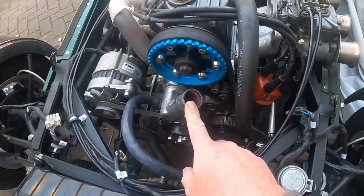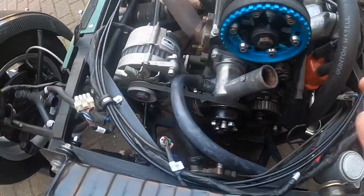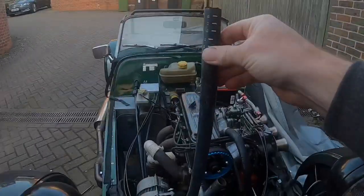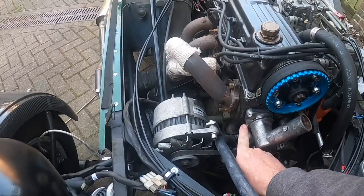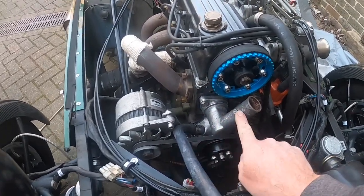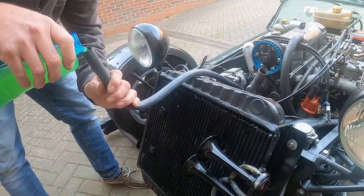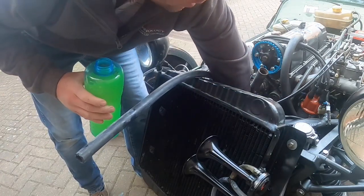I've now got to reassemble the rest of the top hose and also the breather hose which goes off to the header tank. First of all I'm going to top up the water level so it comes up to the level of the pump, by filling up this extended hose. This is my new hose - I'll cut this down to length. I can hold this high, allow the water to drain in, and I know that the water can come into here through the breathing holes and allow the air to expel through the hole I made in the thermostat. I should be able to get the air up here so I can continue filling. I'm filling up very, very slowly just so any air escapes as the coolant goes in. What I like to do is just squeeze the bottom hoses - just pushes any air around the system.